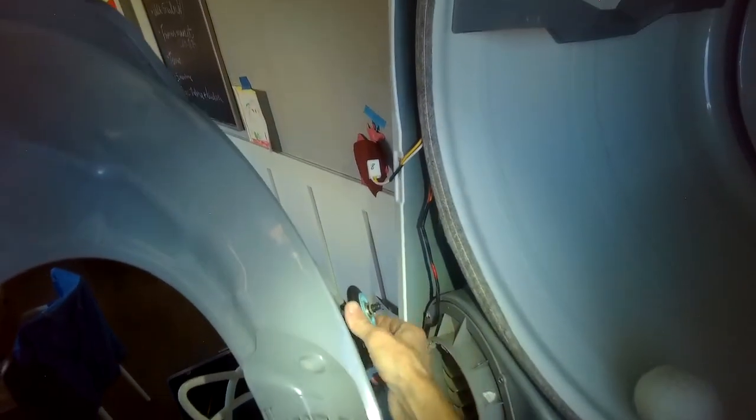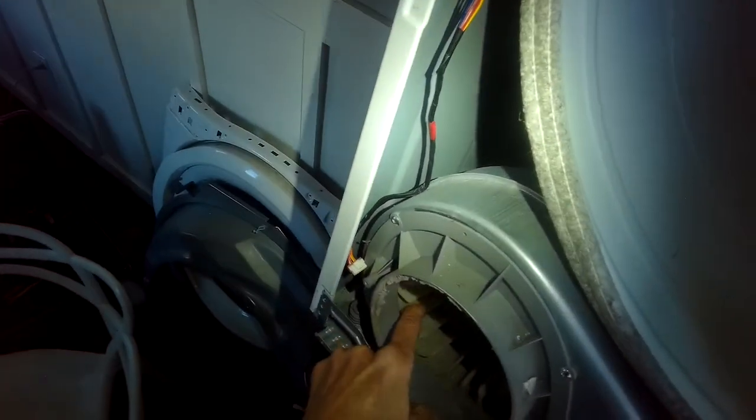There we go. Okay. So one thing you can do is just look at these wheels. That one seems fine. And that one's fine too. They're spinning great. So it's not that. I've got a feeling it might be something with the belt. All right, there's the belt. Looks like it is on there correctly. Feel back there what's going on with the belt. So I'm going to move the idler wheel that way to take the pressure off. The spring's pushing it this way, I'm going to move it this way. And I can take the belt off of the lower wheel connected to the motor. Okay, now that's off. And now this will come out. Should we have enough room to get this out? Pull this out towards you.